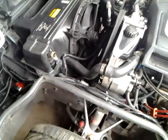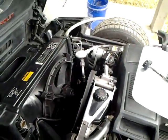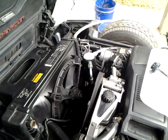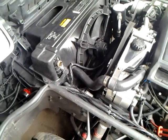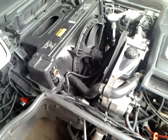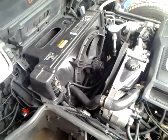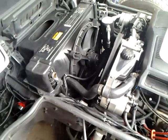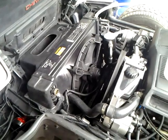I take the upper hose off, and I got a water hose, just a little more than a trickle going in there, and I let it run for about 10-15 minutes until clear water starts coming out. I already did it with the car running — about 10 minutes, maybe another 10 minutes just letting it sit here and flush, with my heater wide open, and everything's flushing through.